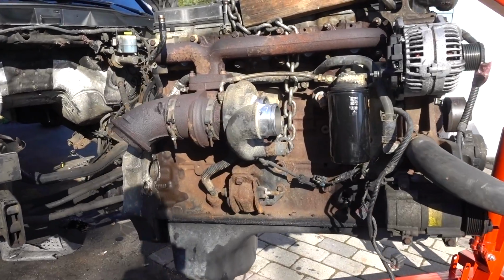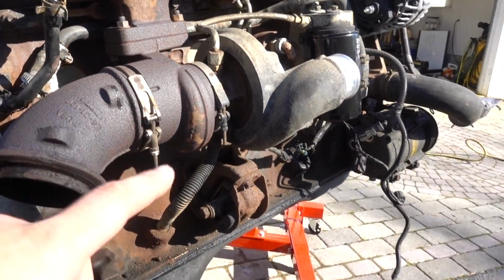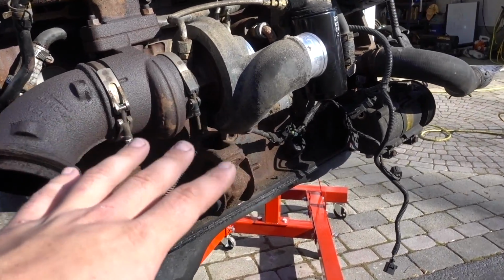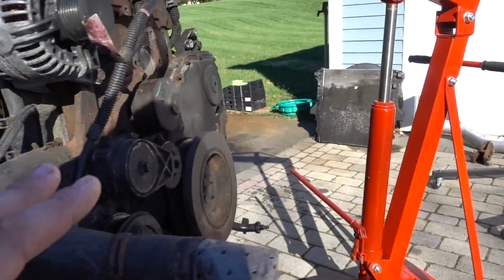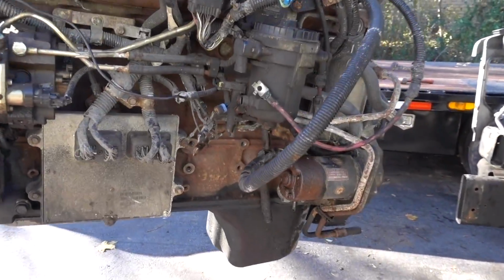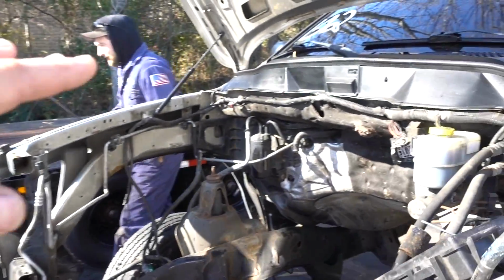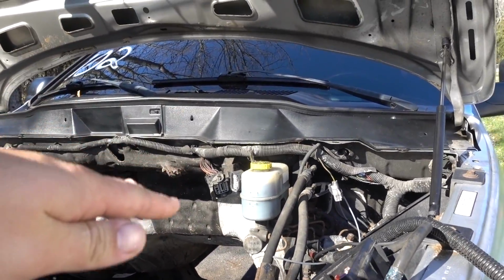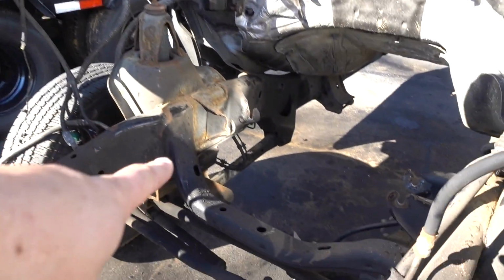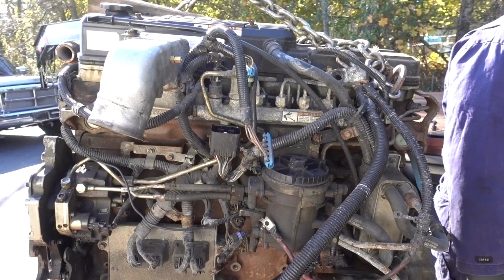Alrighty guys, she is out finally. As you saw, maybe you didn't, we were actually going to take this side engine mount, but we were able to snake it out of there without screwing with that engine mount. The other one though, we did actually take the engine mount completely off the side of the engine. With the valve cover and the cowl, you definitely have some clearance issues going up far enough to get out of the cradle pockets on the frame. So there we have it complete.